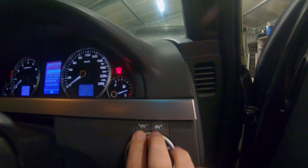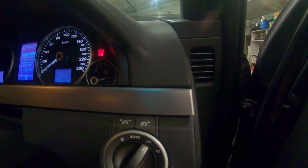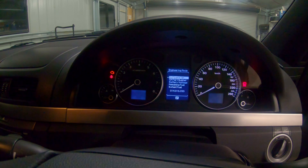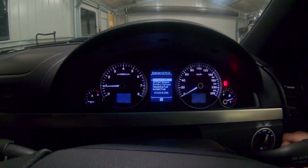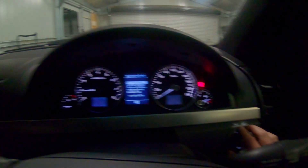I'm going to show you another trick while I've got the dash on — there's a night mode on these things. All you need to do is push and hold these two buttons, which is the dimmer, and it'll basically kill all the lights and all the gauges apart from your speedo. This works — if I start the car and shut the door you'll notice nothing else is on inside the car. That's designed to keep it pretty dark and keep your eyes focused on the road, especially in the outback where it's dark. There you go.